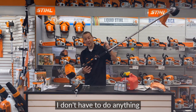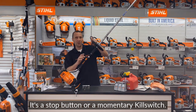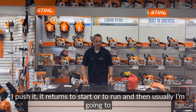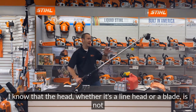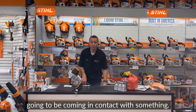I don't have to do anything here. It is always ready to run. It's a stop button or a momentary kill switch. I push it, it returns to start or to run. And then usually I'm gonna put this down on the ground, I'm gonna put my knee on it, and I'm gonna pull the rope. That way I know that the head, whether it's a line head or a blade, is not gonna be coming in contact with something.